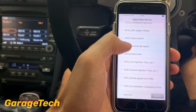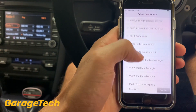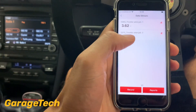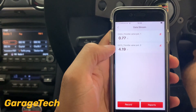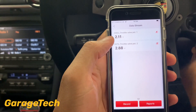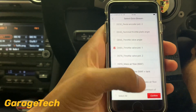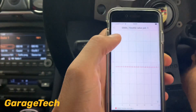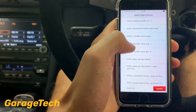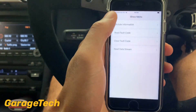Under actual values you can check engine speed, load, and for example the throttle valve — which gives you a voltage reading. The throttle body has two sensors both working in a 0–5V range. As a sense check, one voltage goes up as the other goes down. In graph view you can see the readings move as I press the accelerator pedal, which is quite useful for simple diagnosis.